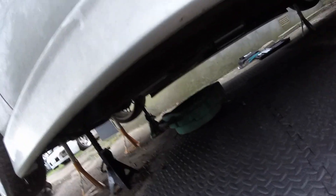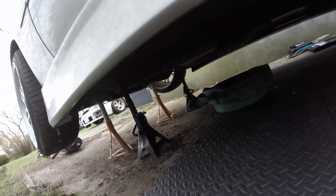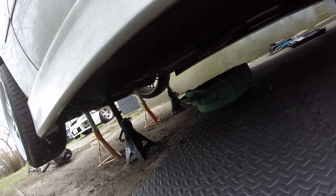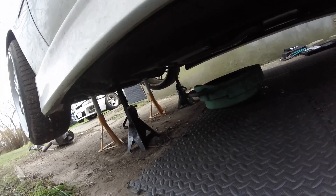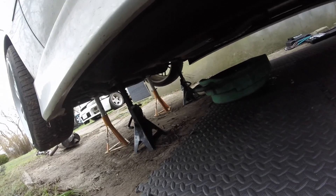I've got the oil draining — just letting most of it get out so I don't get any nasty drips later. It's impossible to get all of the ATF out because automatic transmissions have anywhere from seven to ten liters of oil. I'll probably let it drain overnight to get most of it out. It's starting to get a bit chilly — not that it's been warm. Then I might look at taking that front exhaust pipe off for better access, and then we'll start looking at getting that box off.